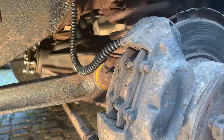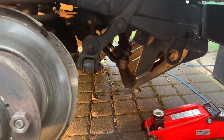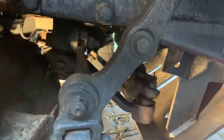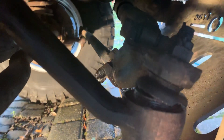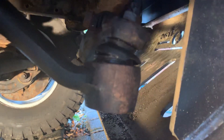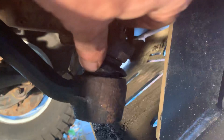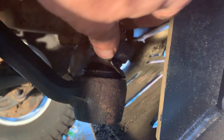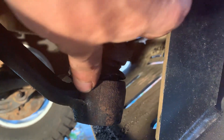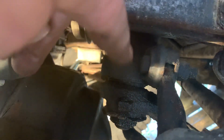If you've got any questions, comment on the video. The vehicle is staying up on the axle stands. I've also noticed an MOT failure — just down here there's a little joint where the rubber has split, just behind the sump guard. Any MOT inspector will notice that. This is the bottom of the steering box — I've got a split on the rubber there which is definitely an MOT failure.